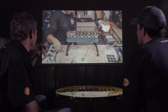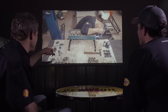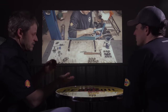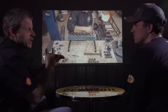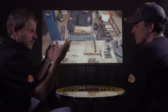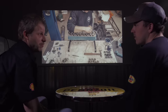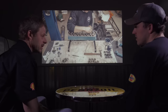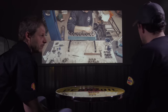One of those late-night cleanup jobs: I did some light porting work on the back side of the valves — in the port, behind the seats. When you machine in hardened seats, there's always a ridge because the seat is typically smaller than the counterbore ID. I take a die grinder and go inside there to smooth that ridge out. I don't go crazy with the porting, but it helps the flow about 30 percent easily. I do it on both intake and exhaust — you're just smoothing the airflow in and out.